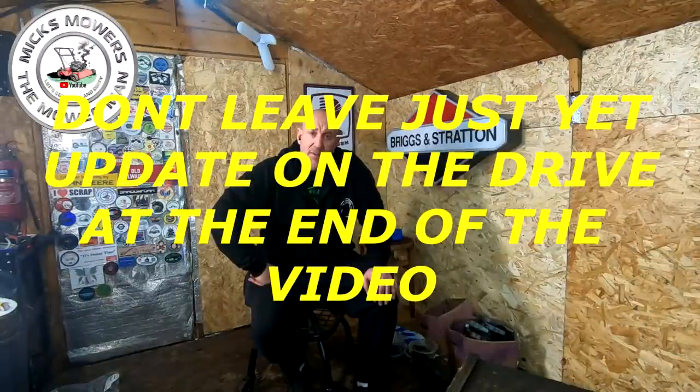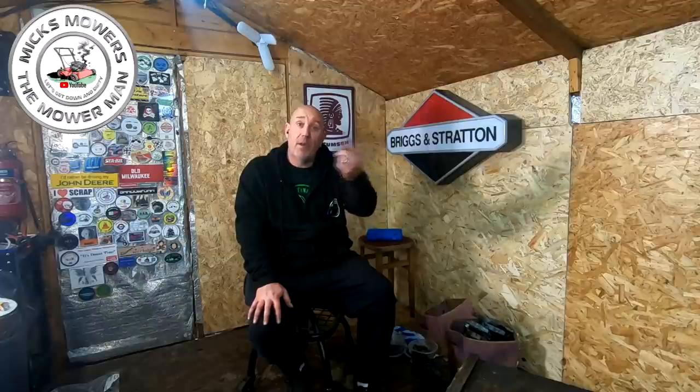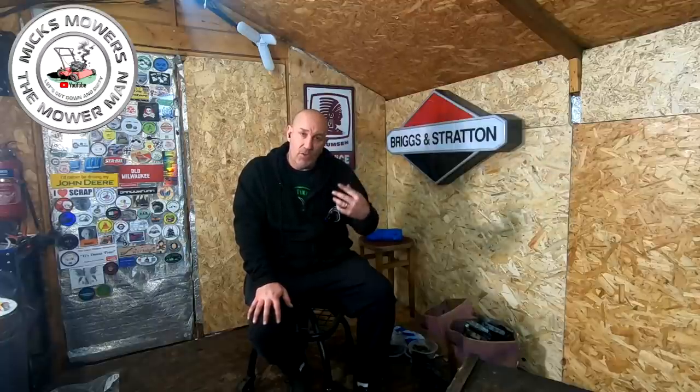I have tried to do this video step by step because lots of people have been asking me how to fix this problem. And although I do still have an issue with this machine, it's like a clunk, clunk, clunk. It can't be belts because the belts are all smooth. I have a feeling on the left-hand side from the back of the mower, there is a drive chain which transfers from a Vari belt coming down onto a drive chain off of a gearbox. I've got a sneaky feeling there's something going on in there, so it might just be a worn sprocket or something along that line. I'll get to the bottom of it.